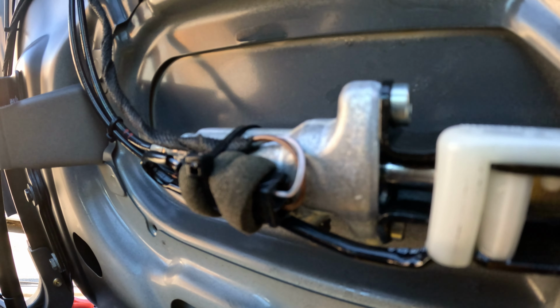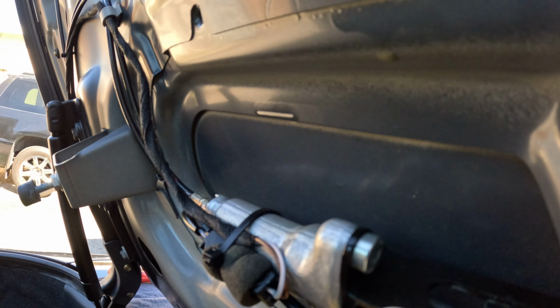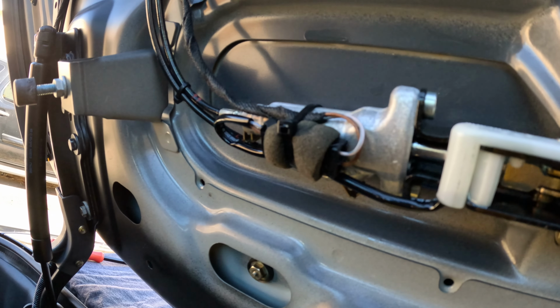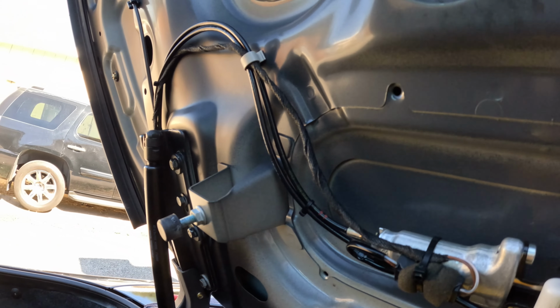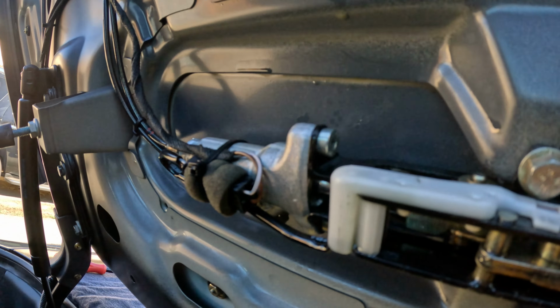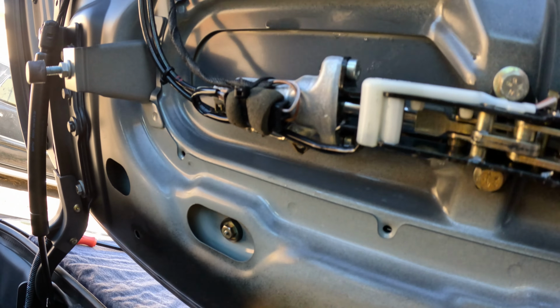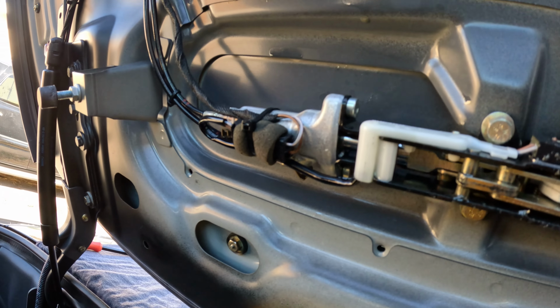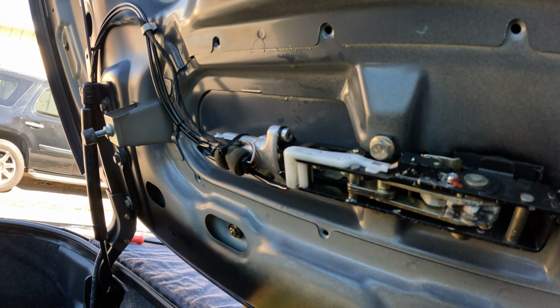All right, it is the leak. I found it. It's coming out of that rod right there, so I guess the seal is bad. I think they have a repair kit. I'm gonna see if I can order it on eBay, but yeah, it's coming out of the cylinder right there. That's good because I don't want it coming out of the line. That's hard to repair. I'd rather repair a seal. So let me see, a couple of Allen wrenches and it comes out. All right, I'll see if I can find a repair kit.